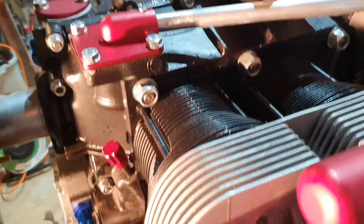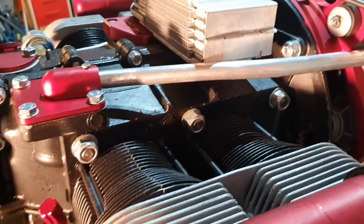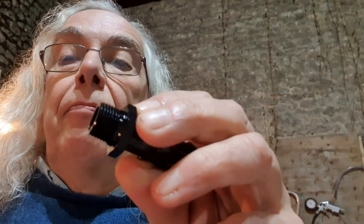That took me pretty much all of yesterday to do. The good news is I've had my delivery of parts that I ordered the other day from a very good company in Holland - it's easy and cheap to get stuff sent here from there. Most items were okay, apart from this fitting which goes in the top of the oil catch can - I got the thread size wrong. This is a 3/8 MPT and it should have been a half inch MPT. Stupid me!